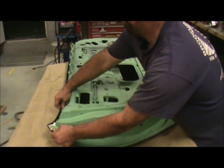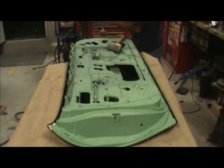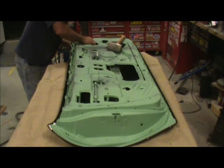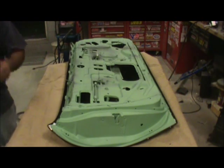Getting a tight gap up here on the door — less than three-eighths than I had on the other door originally. I had a quarter inch on the other skin and I'm not getting it here. It looks to me like the whole door is kind of cocked.